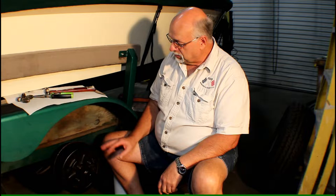On this particular trailer, this is a boat we picked up a few weeks back and we had to drive it about 500 miles to get it back here. We did the real basic trailer maintenance before we left — we changed the tires because they were nearly 20 years old, lifted each wheel and spun the bearings. They didn't sound like a gravel truck inside, so we added grease and drove it home without any incident.